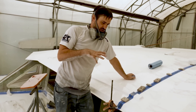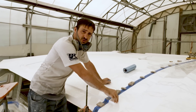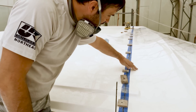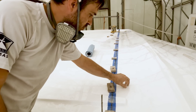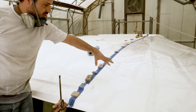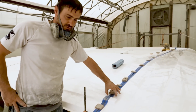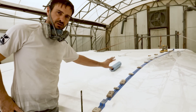As always we went through and thought we had the process - we dry fit, went through the process a couple of times just to make sure everything was setting properly. We did everything we could to prepare for it, and then when we did it, it was not aligning. The two pieces were getting basically a high spot here - it flows properly this direction and flows properly this direction, but we have a high spot there and no matter what we did we couldn't get it to not happen. We tried pulling this up, we tried putting this down. But I think we have it now aligned properly. Once I do the glass work here to pull these seams together, that should end up getting rid of that high spot and get it a nice transition from side to side. Then we're just going to load it full of filler and you're never going to see it.